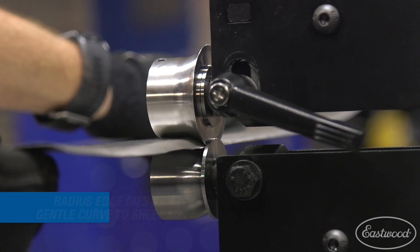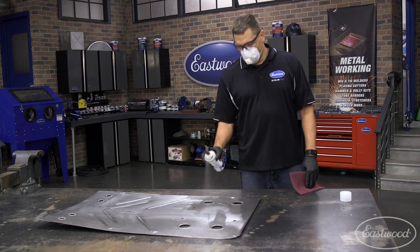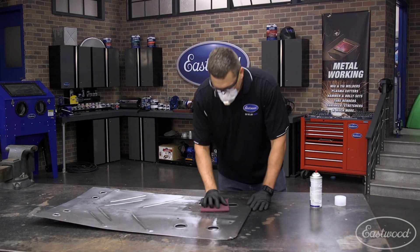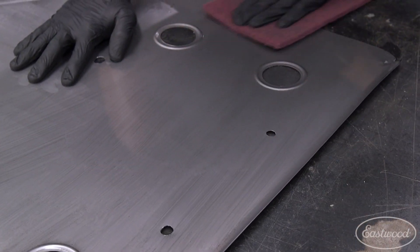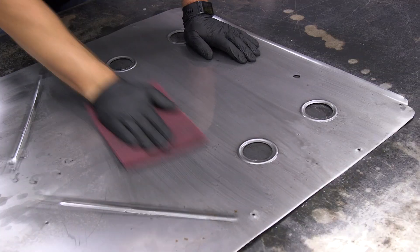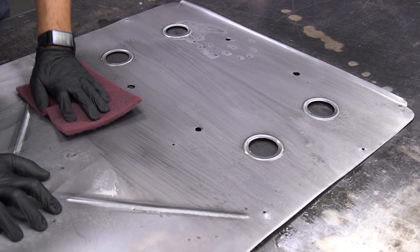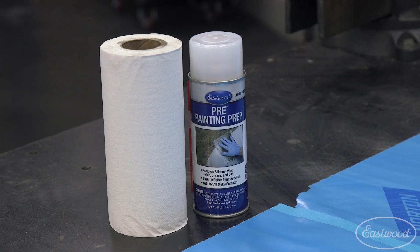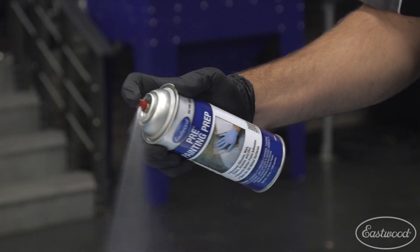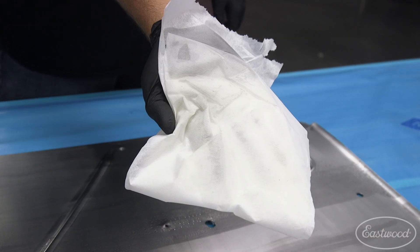We voted to leave this floor panel in a bare metal look to add a nice contrast to the black frame. Wanting a brushed look just involved taking a maroon scuff pad and our pre-paint prep to wet sand the metal, which leaves a nice brushed appearance. Before any paint job can start, it's exceedingly important to ensure a thoroughly clean surface — don't be afraid to keep cleaning until the rag comes back clean.